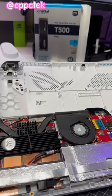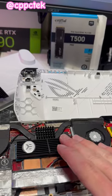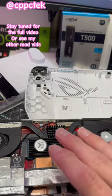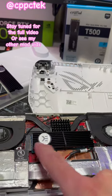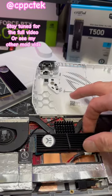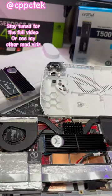First of all, if you already have the drive, I would recommend grabbing one of these EK Waterblock NVMe heat sinks. They're really good, but there's one caveat: you're not going to be able to use the mounting bracket that it comes with. You will need to attach it with a thermal pad and some rubber bands, which is completely fine. Then put some type of heat shielding on the back so the APU doesn't force a bunch of heat towards it.